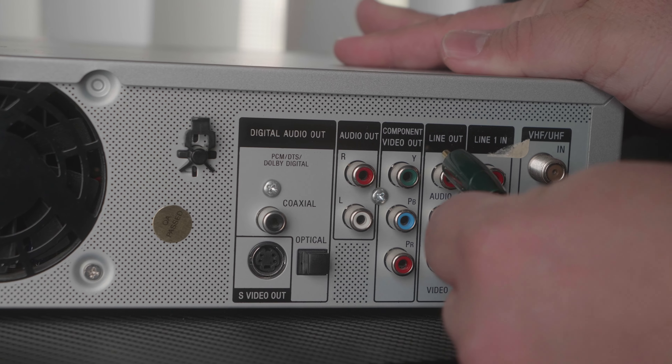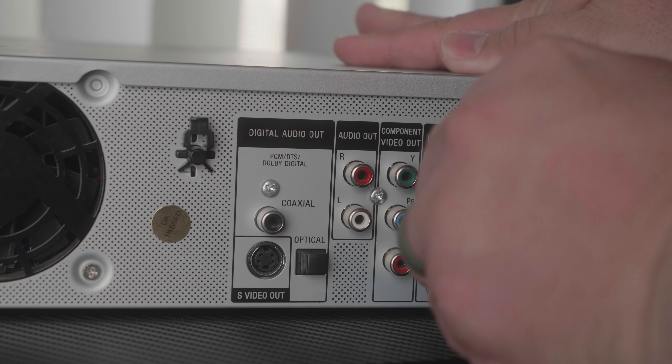It lets you send an unaltered audio signal to external devices for recording, processing, or even multi-room audio. For this project, I connected the tape out to the VCR using generic RCA cables. That way I could record music without any changes from the preamp — so even if I adjust the volume or tone controls, it won't mess with the recording. It's a handy feature for obscure projects like these. Once I connected the VCR to the preamp, I hooked up the VCR's audio output to the tape input on the preamp so I could listen to my recordings after they were finished. Just remember, you'll need RCA cables for all these connections. Once everything was connected, I opened up one of my new old tapes and started recording some of my favorite songs from my CD collection.